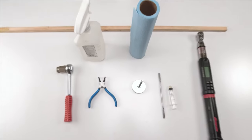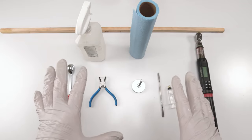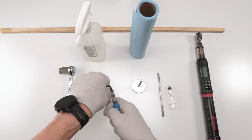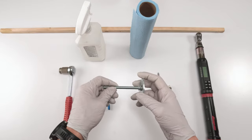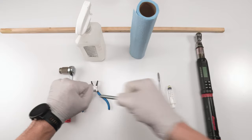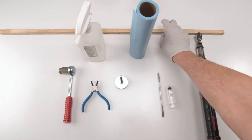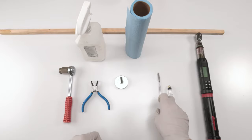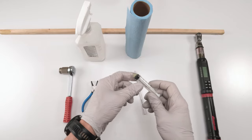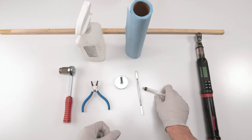For cleaning the lowers, you'll need a dowel — preferably a square dowel — with towels, a rubber band, and alcohol. We'll need a container to put our foam rings so they can soak in oil during the process to make sure they're nicely saturated. We'll need grease for the wipers, a 32mm wiper installation tool — this is a cheaper Amazon one I'm testing, about 10 to 12 bucks. You'll need a torque wrench, and when you're done, an air pump to fill it back up. For the air spring, you'll need a cassette tool with a ratchet to take off the air spring cap, and a retaining ring plier to take out a retaining ring.